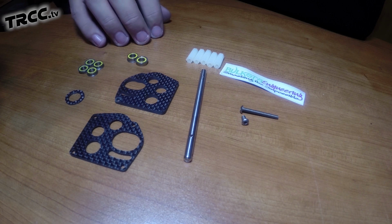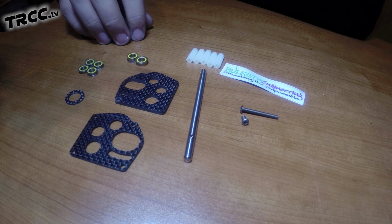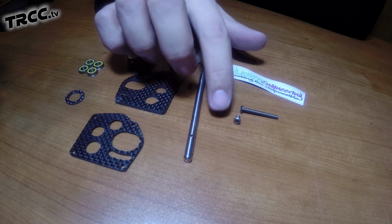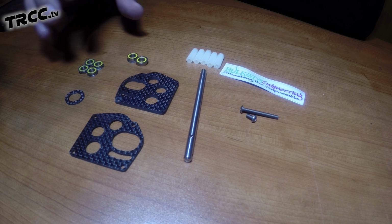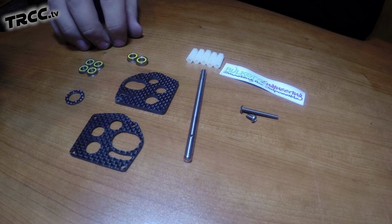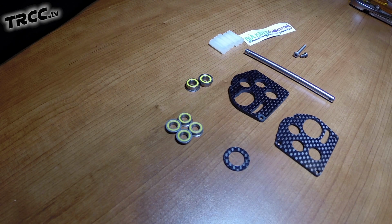And so, according to the manufacturer Hulksta, we are going to need 6 M3 by 6 millimeter screws, similar to these ones, and we're going to need the XR10 gears that come either stock in the XR10. You could use the Axial lightweight. You could use the RC 4-wheel drive. I'm going to try the stock ones because typically the stock ones are okay.